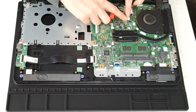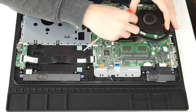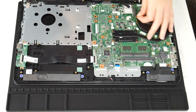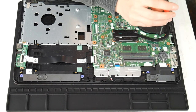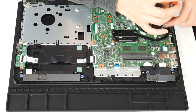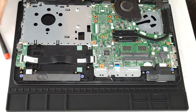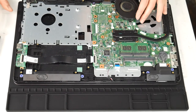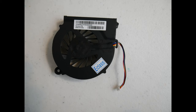Next I'm going to show you how to clean your fan. This is another big reason why people have issues with their computer overheating. I'm going to unplug it and then take the two screws and undo it. Now that I've examined my whole board and cleaned any spills off of it, I'm taking the fan off. I'm going to take a high pressure air cannon — you could also use a hair blow dryer or a can of compressed air. I've included the can of compressed air and the air cannon down below.